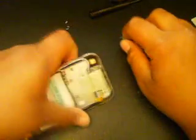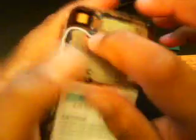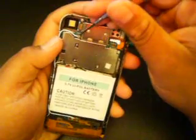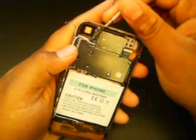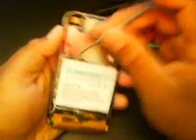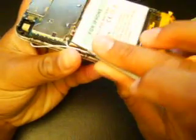Now there are two antenna connectors — one right there, right there. You're going to get a small screwdriver and take those off very carefully. You could damage your phone if you do not do this carefully. They will be held on by glue, so it might take a while but it should get there. Same thing with the other one — there you go.